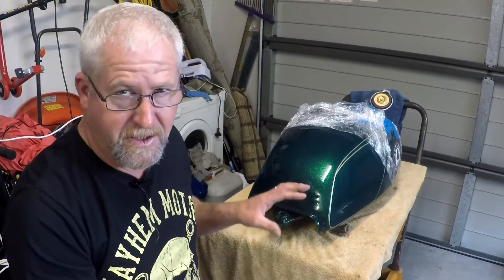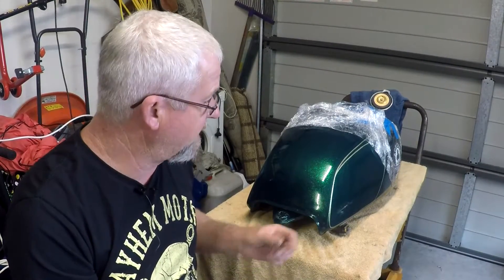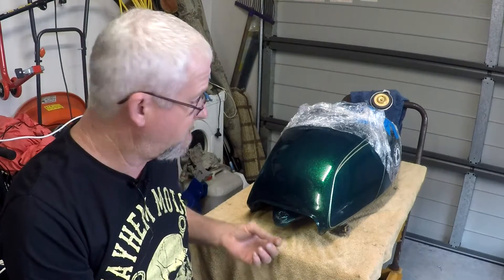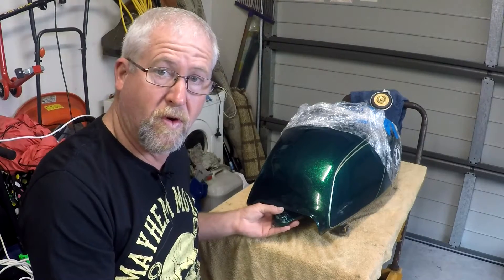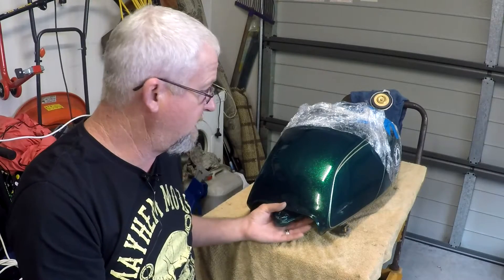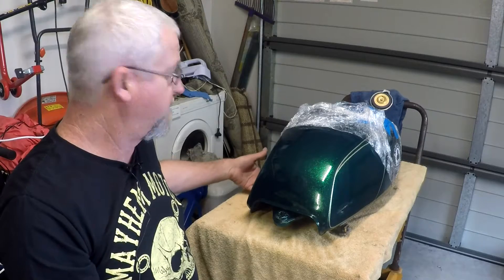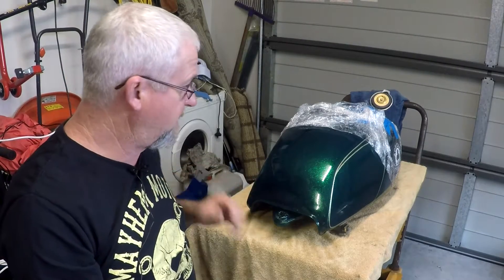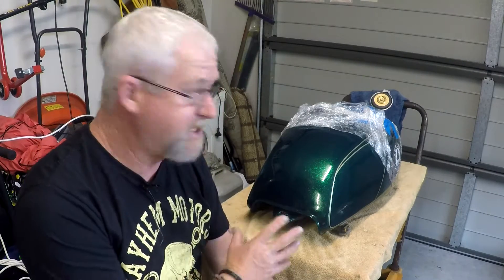Welcome back to day 2. So I had a few issues. I'm glad I took the time and trouble to do this - I was actually going to risk not putting a liner in this tank. There are pin holes in it, one or two pin holes where it's rusted through from the inside. One of them is at the back where the mount for the tank welds onto the base. There was a pin hole just forward of the fuel tap on the left hand side, and also some leaks around the tap. So I'm pretty glad that I did this.